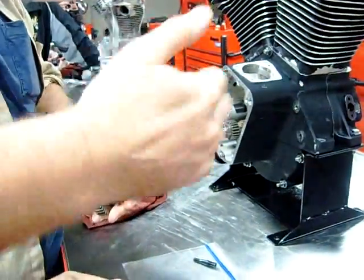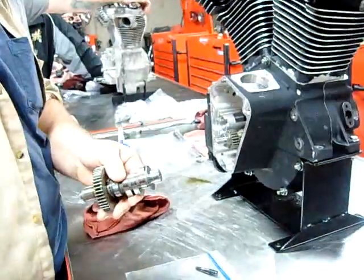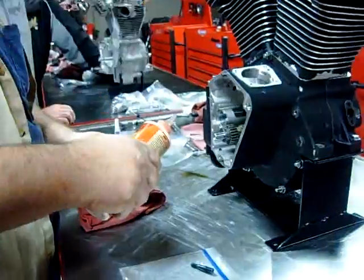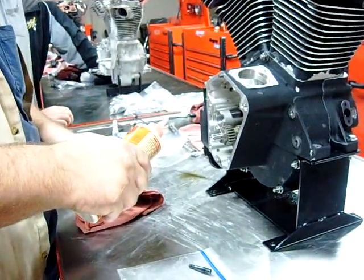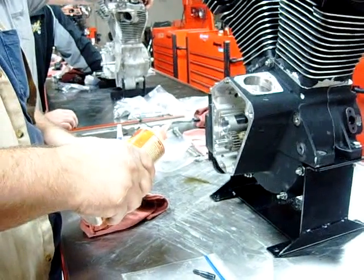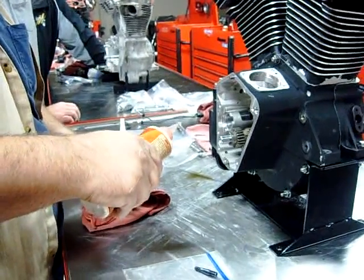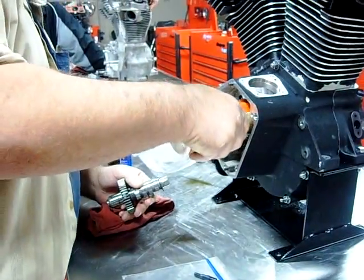Does anybody remember what that maximum end play amount was? 4.5 thou. No, that's the run out for up and down. I'm talking an end play back and forth. It's a big number. 15 to 30. That's side clearance. Camshaft end play was like 50 thousandths. It was quite a bit of room they'd let you move around in there.